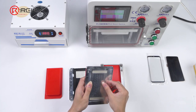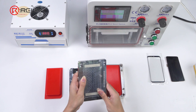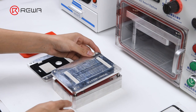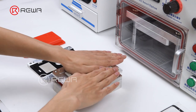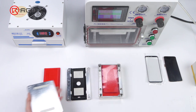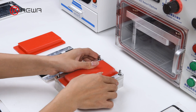Place OCA into the corresponding position of the OCA lining mold and apply pressure to get it adhered tightly. Then embed the OCA lining mold into the base. Apply pressure to fit the OCA against the rubber block. Once done, press carefully to remove bubbles inside.